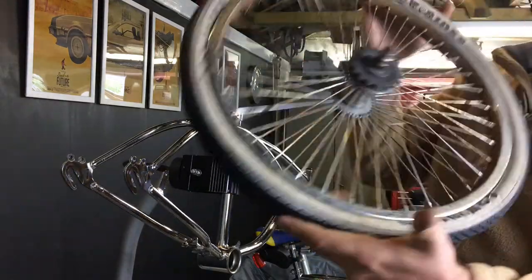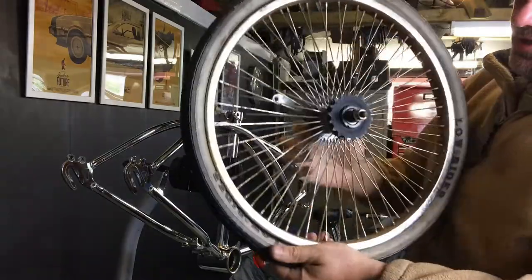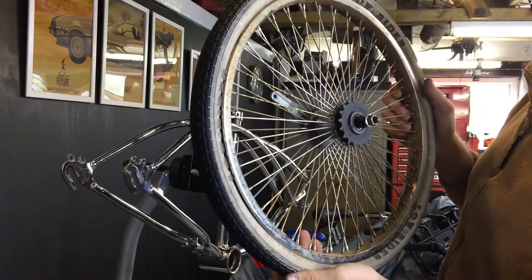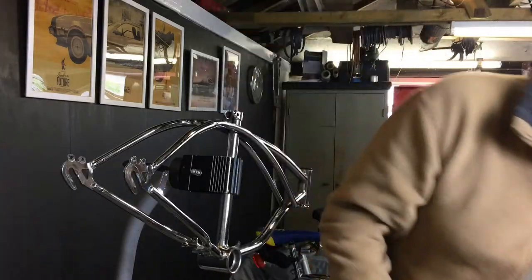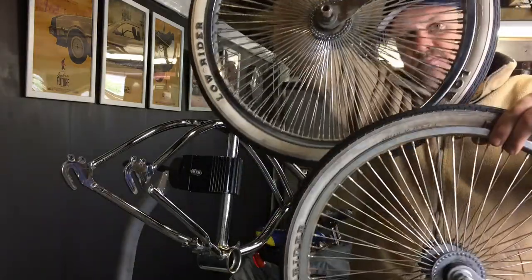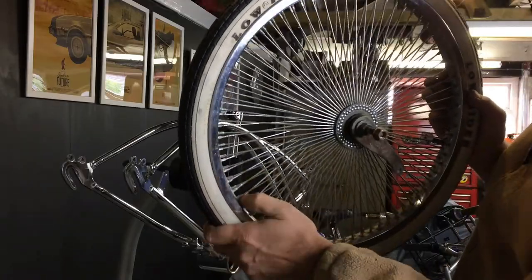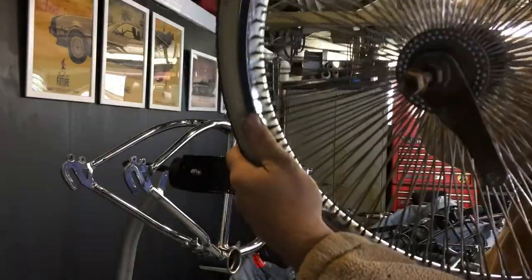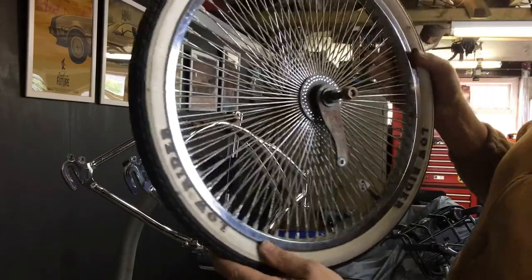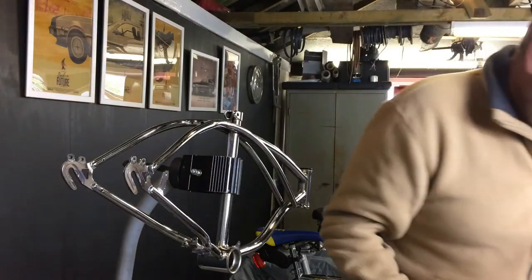And then you may remember the 72 spoke wheel, the rim would come up again. I think there's some bad areas there, but to be honest, as I said earlier, although it's got the coaster brake and original tyres, which are in pretty bad condition, it's the less desirable 72 spokes. So what I've got off the shelf is 144 spokes. I'll try and hold those up to the camera so you can see the difference between the two. This does need a little bit of work. Tyres in better condition. I remember on this bike, somebody's gone to town with chrome cleaner. Don't know if you can see that in there. But the rim's overall good, and I've managed to do a full strip and take all the spokes out, polish the rim up and then rebuild it, redo the coaster brake, clean the tyre up, grease and service the hub, etc.